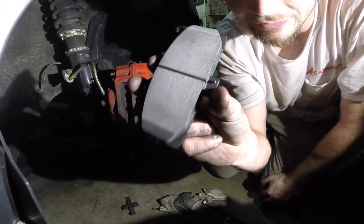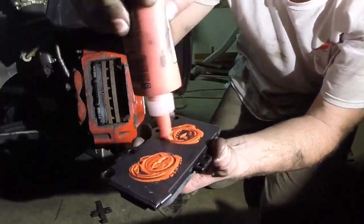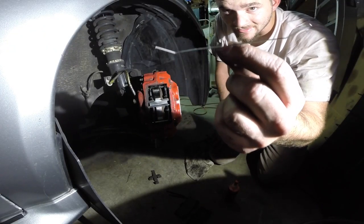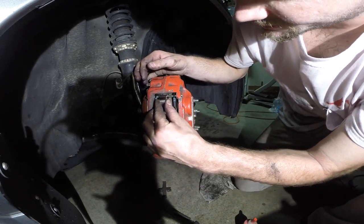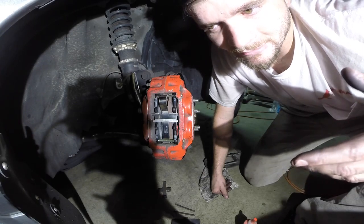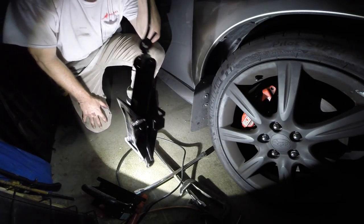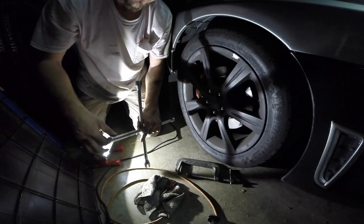And with the new meats — almost forgot the Stop Squeaks. You know the next step: we're going to put the pins in. Last step is this little pin — it'll save your life. Experts at this by now, right? Bam — snapped right into place. We are good to go. That's how you do a brake job. We're ready to throw the wheel back on. It's about 9 o'clock at night, so it only took me around an hour. Don't forget to torque your lug nuts. Done.